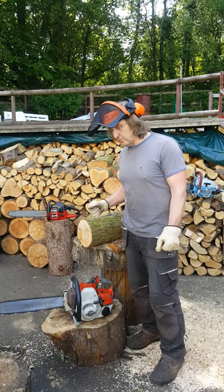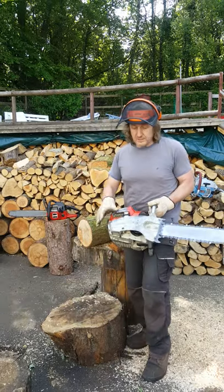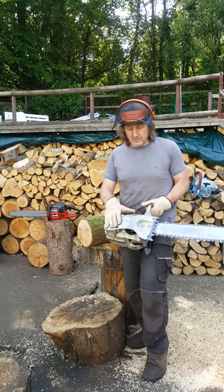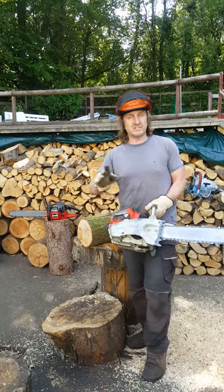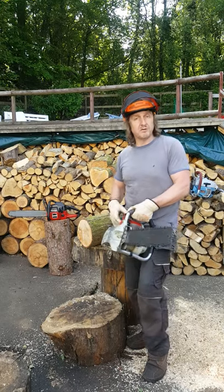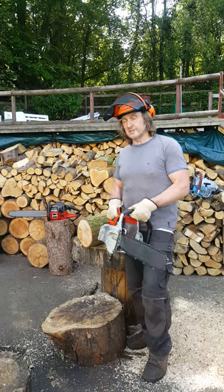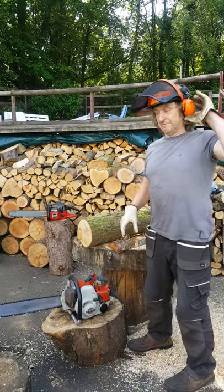And then, of course, if you had a later version, so I'm presuming this is the older one because of the moulding into the side cover. I think the later ones were an inset aluminium badge from 69 on. Apparently then they're 56cc's, but the only way you'd really know is by measuring the piston. So I'm unsure if this is a 48 or a 56, but I'd say it performs like a 56. Anyway, let me show you how she cuts. She's gorgeous.